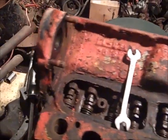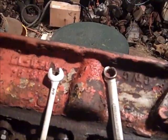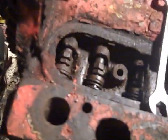I was working on this a little bit and I got the camshaft loosened. I tapped it on the end with a hammer and it moves back and forth just a little — so it's not permanently stuck, which means we'll get it out. But here's two pieces that are going to be a pain: that rusted-up governor, and this oil pump has been underwater for years. They don't have any new oil pumps, so I gotta save that one. The governor probably has something similar somewhere but it'll clean up. Might break a couple valves but I can get new valves.